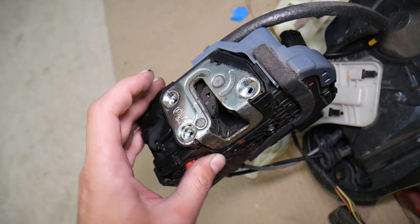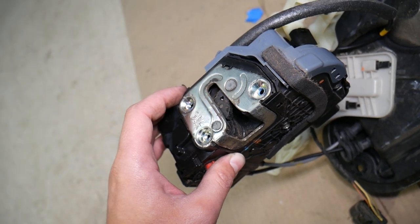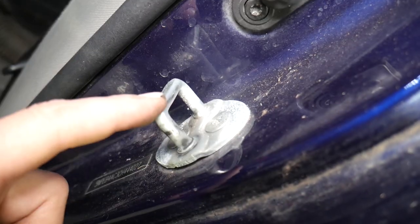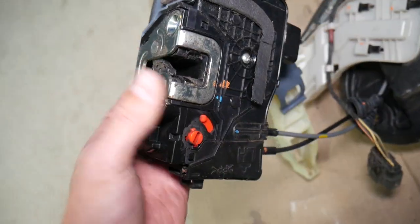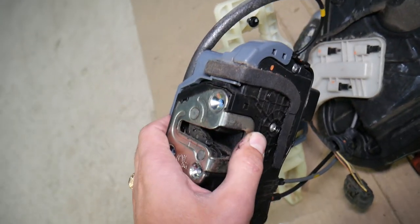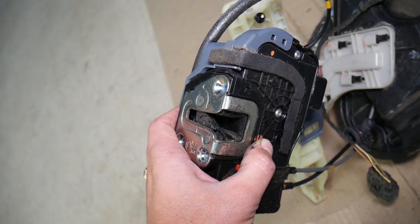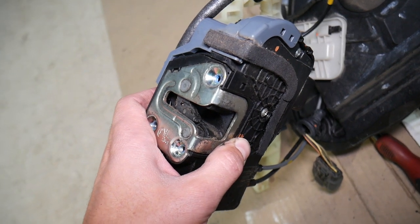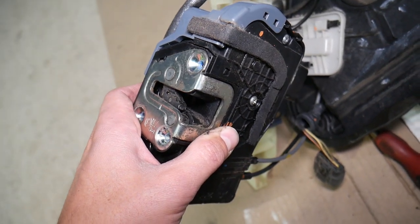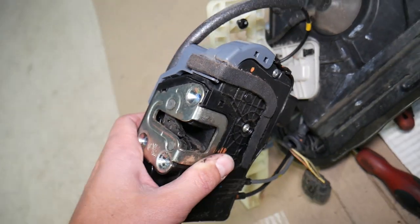A bad door lock actuator — that's the device that opens and closes your door. It gets stuck. If you see right here, that's where it closes — that's the latch. Practically, you have a gear with a motor inside that locks and unlocks, which can activate or deactivate the interior and exterior door handle. If that gear wheel cracks, it starts skipping, or the motor quits working, it will not lock or unlock.